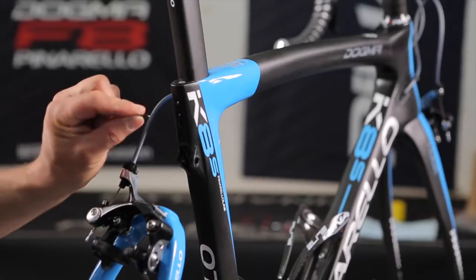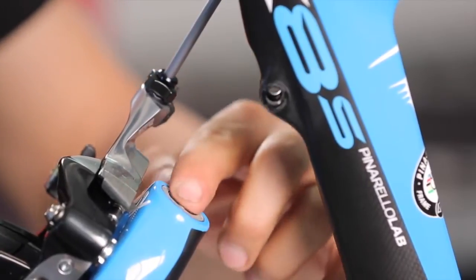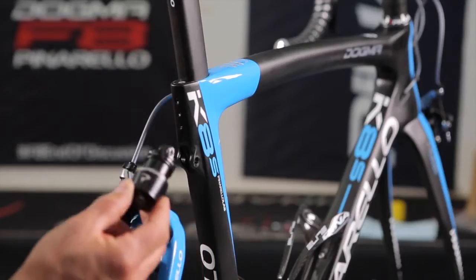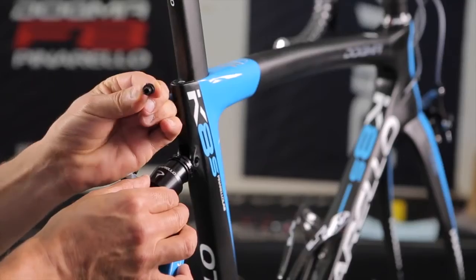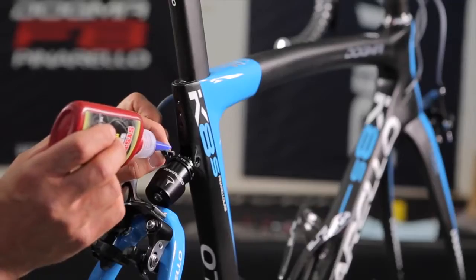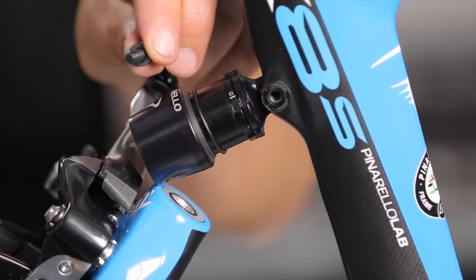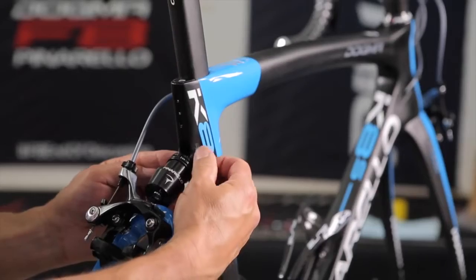Place the o-ring with inner diameter 12.1 millimeters in its seat on the frame. Then place the suspension in the top support and fix it through the shock bolt. Add a small amount of medium thread locker on the screw.